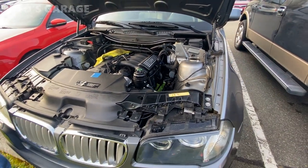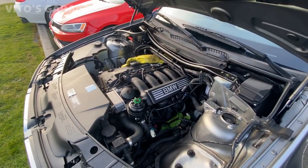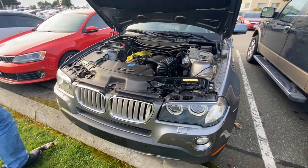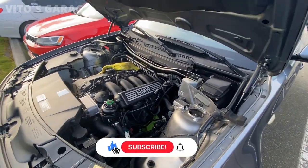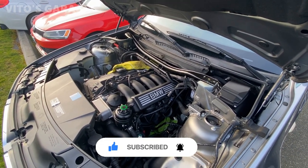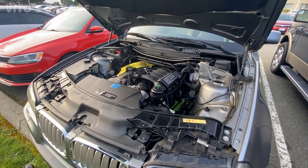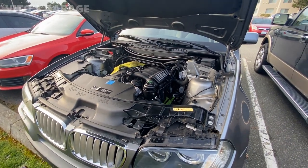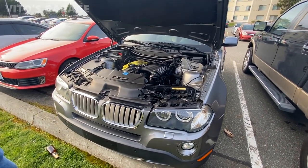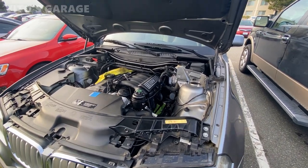We're waiting for him to come back. He'll be back shortly, so we need to figure it out. This car has a no crank, no start condition. He asked me for help because he wasn't able to take out the intake manifold. We'll try to do that so he can get to the starter — it's probably the starter that's bad. It's a pretty common issue on these cars, unless it's something else like the ignition switch or whatever in the starting circuit.